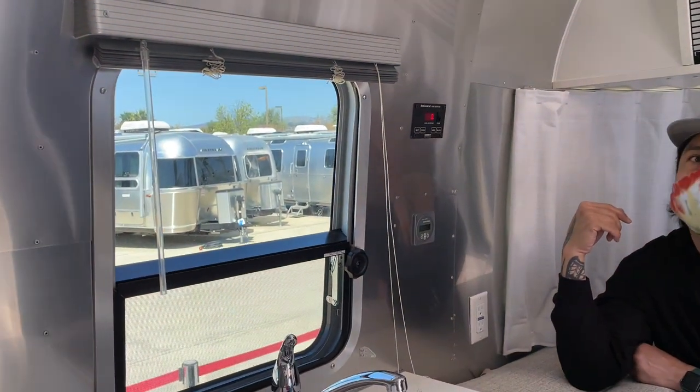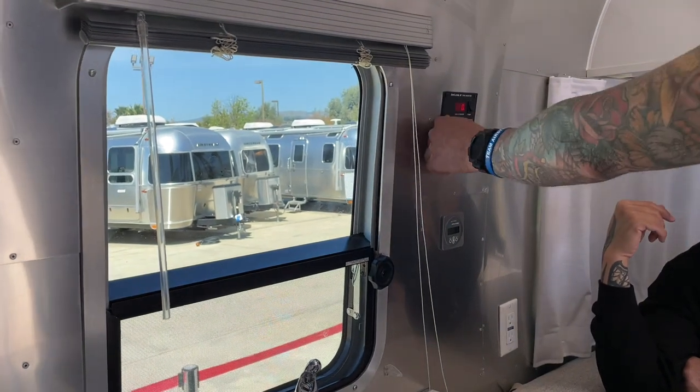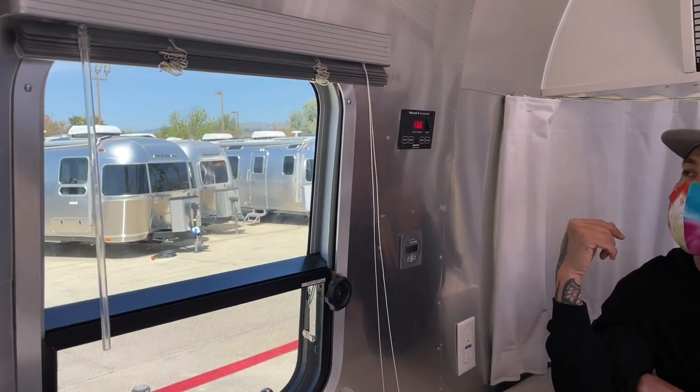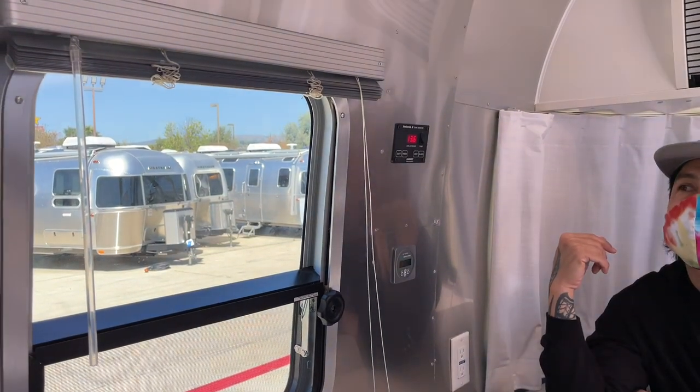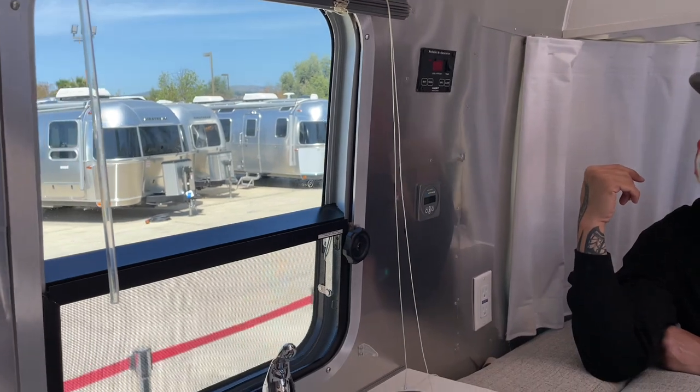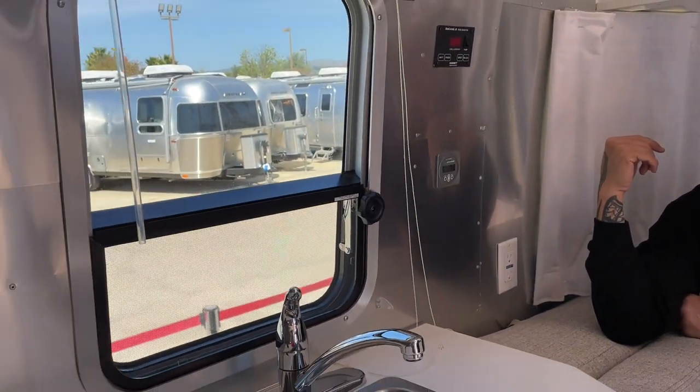So there are really just four readings: battery voltage, fresh water, gray water, and black. For the battery, turn that display off when done — you want to be above 12 volts, always above 12. Your solar is going to help you maintain that voltage as well.